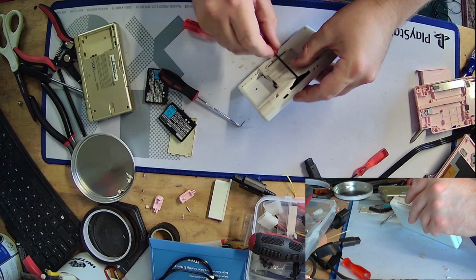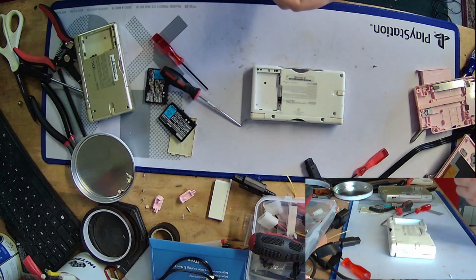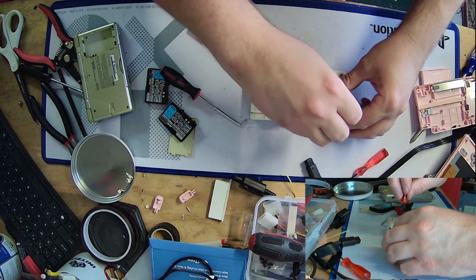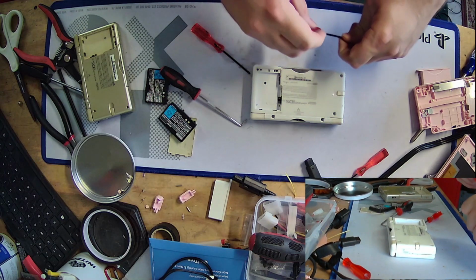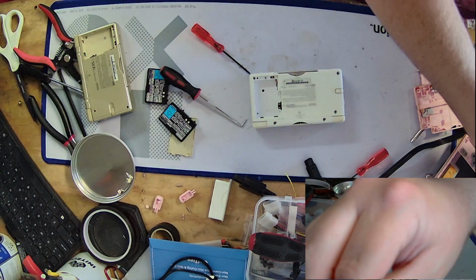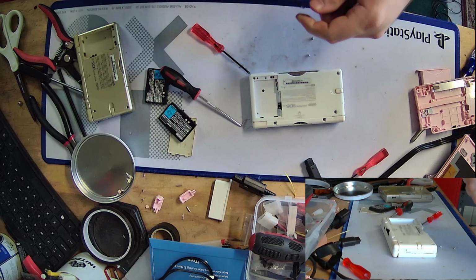And I had already spent a good amount of time looking into solutions for the problem that it had. The problem being where it would blink out of existence if the images on the screen got too dark. And time and again, the answer I saw was it's either the control board or the power board. Most likely it's the controller board failing. And replacing that was not going to be practical. So I decided to throw in the towel, make the executive decision that it was not worth pursuing a repair on it. And so I scrapped it, and he got irrationally upset over that. No idea why.